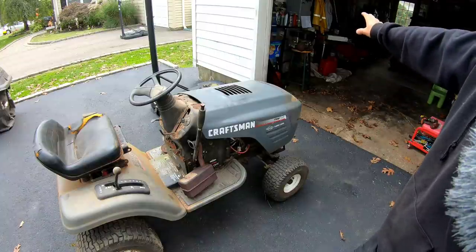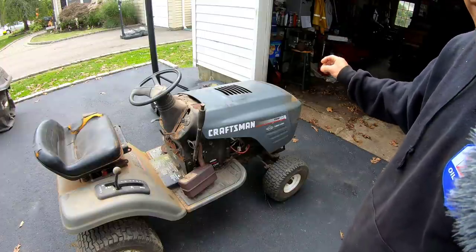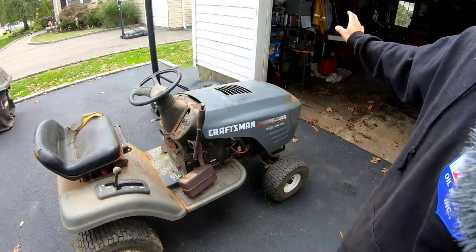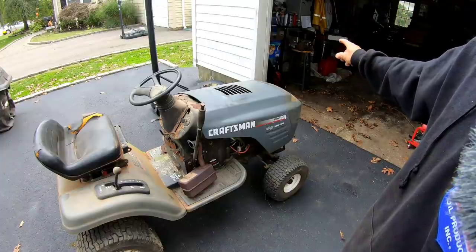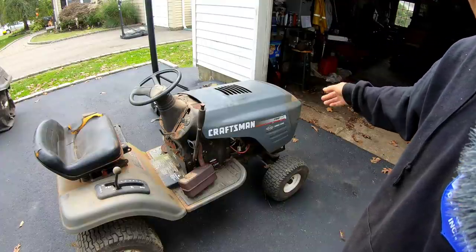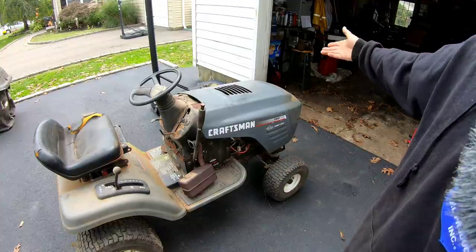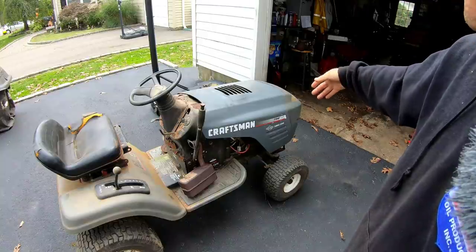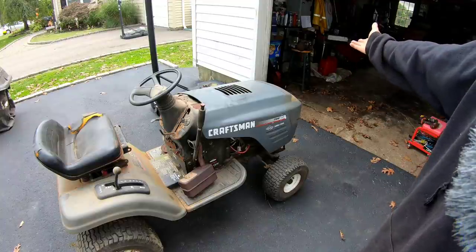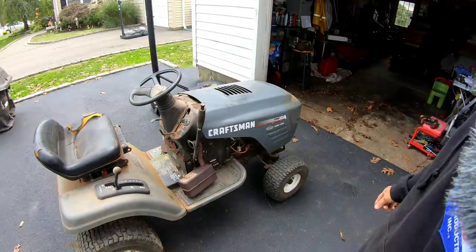As you know from a previous episode recently, I put new valves, well not new, but used, into that 13.5 flathead engine. It has a couple of stripped head bolts in there, so I don't know if the compression is going to be any good. I think basically that engine is pretty much DONESKI because it's not just the valves or the head bolt stripping. One of the valve sleeves is homemade, and it's not supposed to be that way. So if it miraculously starts and works, with time it'll deteriorate and will no longer have compression again. I'm pretty sure that engine is DONESKI, but I'm gonna put it on here just to humor myself to see whether or not it'll start.